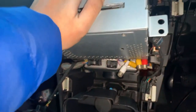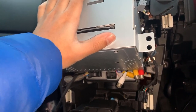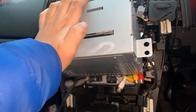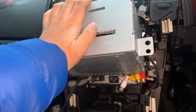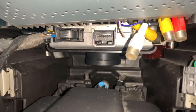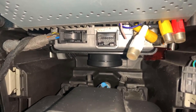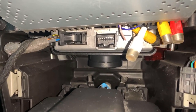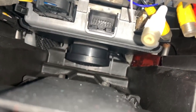Another problem I had was the indicator sounds — they wouldn't appear. I lost all the buttons for the radio on the steering wheel. It was due to this: it comes with the package but I forgot to put it on. That's why the indicator sound was not working. Any beeping sound — like if your seatbelt isn't on — will not work if this one little thing is not connected. It's a small speaker that you attach somewhere, which I've attached over there.